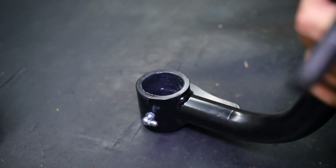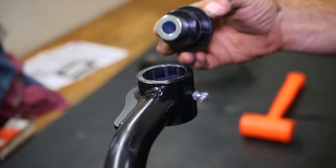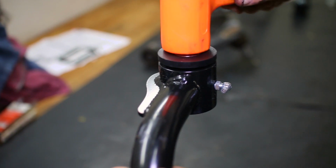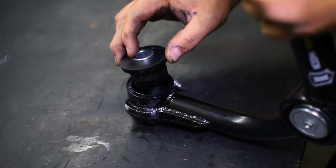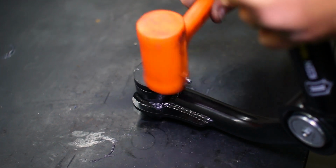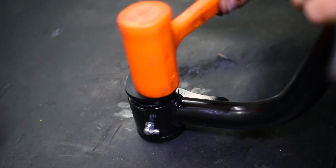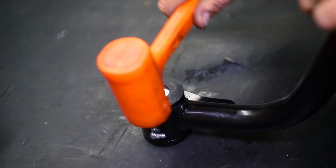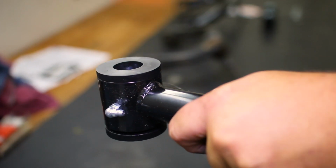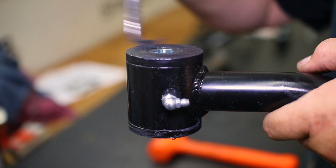Setting up the Delta joint arms prior to install, we grease the fittings where the polyurethane bushing will sit before installing them into the control arm. You will probably need a light tap from a mallet to get them to completely seat in the control arm. We also lightly grease the outside of the bushings to help with installation and to further prevent any possible noises.